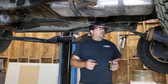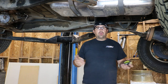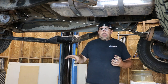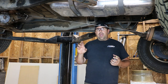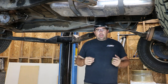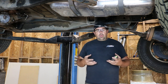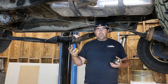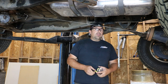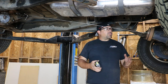There's also half critical speed, which is exactly one half of the critical speed. So if the critical speed was 9000 RPM, the half critical speed would be 4500. That half critical speed is important because of U-joints. When you have an angle on a U-joint, every time it makes one revolution it changes directions twice. That creates another oscillation at half the speed — since it changes direction twice, you divide the critical speed by two to get that number. That number is important because it can also produce a vibration, and on a lot of vehicles that's the speed you run down the highway at — 70 or 75 miles an hour — where it would be most noticeable.